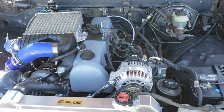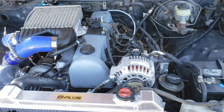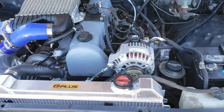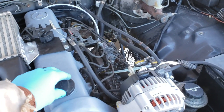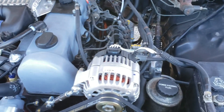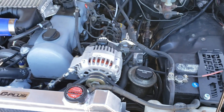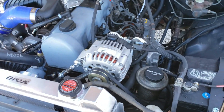Now working our way to the left side — I replaced the radiator hose, and we also discovered the old oil fill cap was not sealing at all, so everything's covered in oil and coolant. But we know why. It's about 10 degrees here right now so I'm not going to be washing it right now.